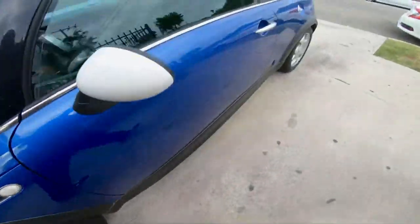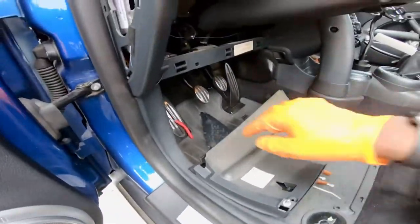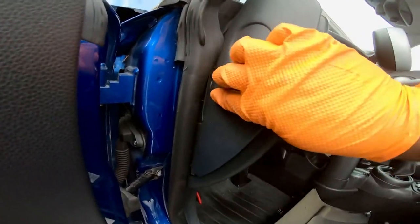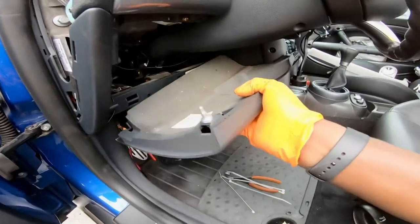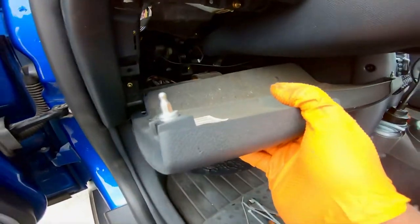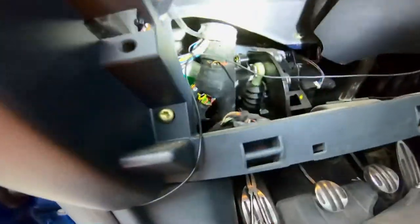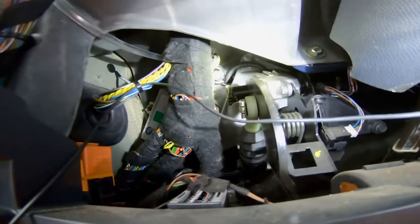And now to the inside. What you're gonna wanna do is pop off the cover from on the side right here. It just clips and it just pops out. And you wanna pop off this as well. It's just held in by this little nut right here. You're just gonna pull and it's gonna come up. And as you guys can see, I accessed the line through there. And I'm gonna run it through here